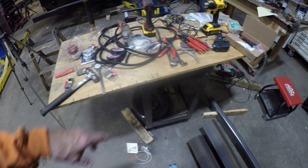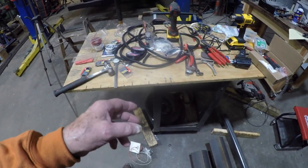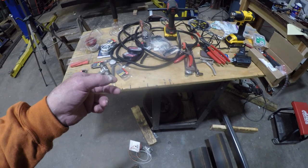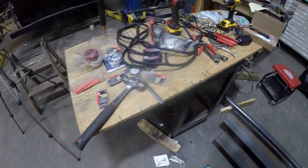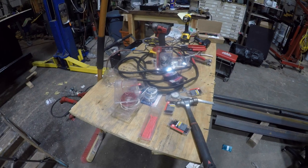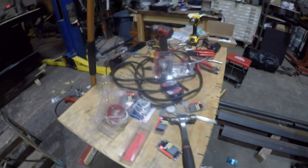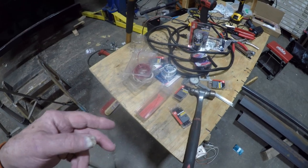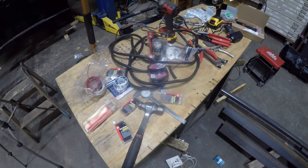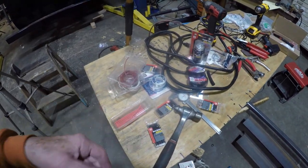The issue is, what I wanted to tell you was, in the other one, the trailer wiring harness, I used crimp connections, and I had some issues with it. I haven't had any recently, but I had some issues with the salt and stuff that they use in the Northeast in the wintertime, getting up into the wiring harness. And some of the connections turned out to be unstable, mainly the bullet connections between the lights and the bullet connectors that I had to get.